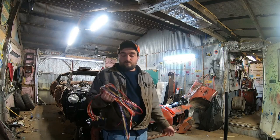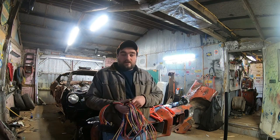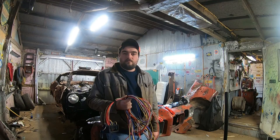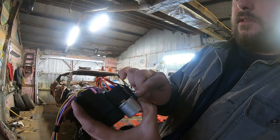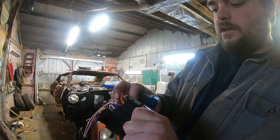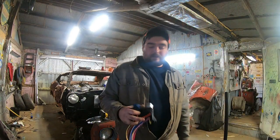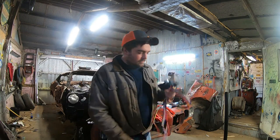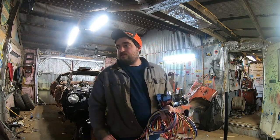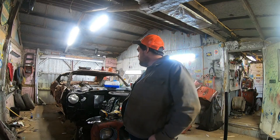But if you're broke like I am, this will work. This will make your car function — I've used them before, they work fine. The wire quality is actually really nice; it's all copper, no tinned crap in there. Watch as I snap this flasher in — see how the spades are actually exposed on this? Look how it's moving the entire terminal. You're going to be able to pull that in and out about four times before that's going to break through the back of that — it's not good at all. And the instructions come in some sort of mix of English and Taiwanese, so I would suggest avoiding these unless you're me.